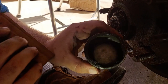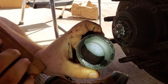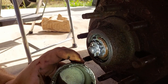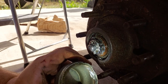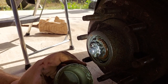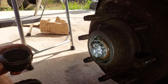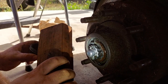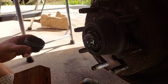Whoever did this last did not see fit to put any grease in the dust cap. And by looking under the castle nut and everything, that grease is brown, which means there was some moisture intrusion in there. So it's going to need fresh grease, and we're replacing the bearings anyway. This whole rotor hub assembly is being replaced, so it's going to get completely rebuilt, packed, all nine yards.